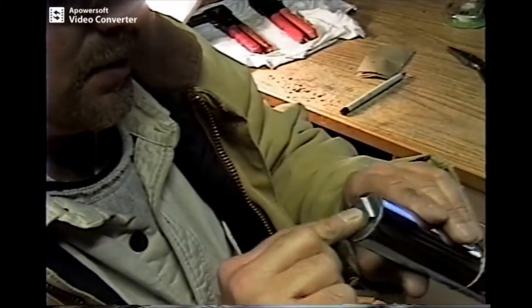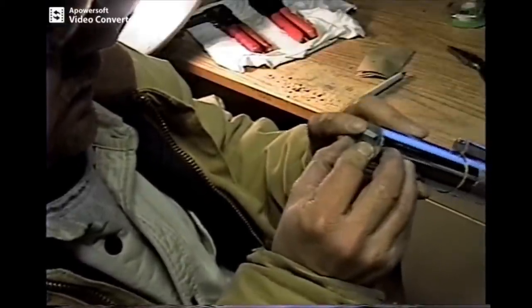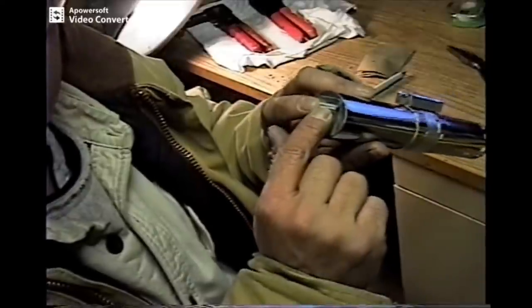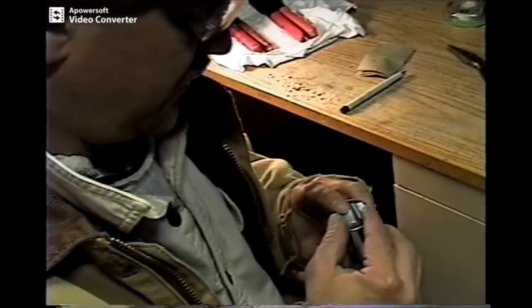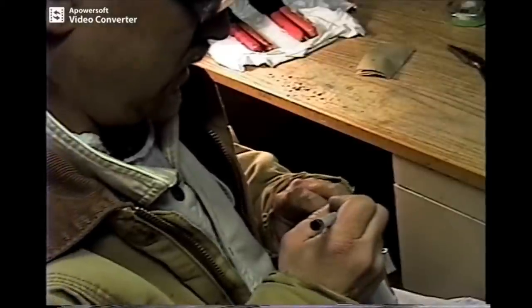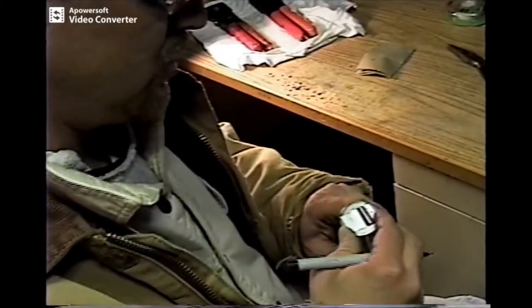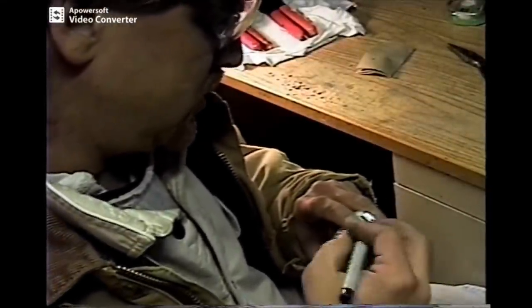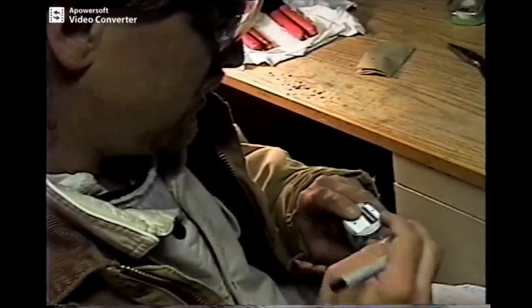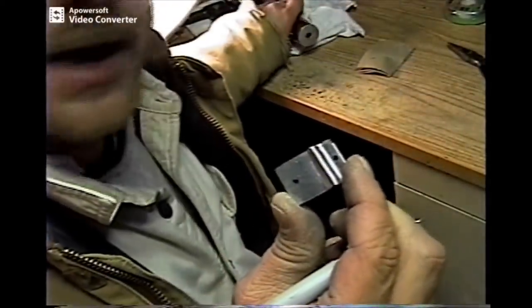Take my tube, smack it on there, make sure it looks alright. Now remember the bent piece here goes right on this side where this clamp piece is at. Take your pen. Make a little mark on top where you want to drill your 1/8 drill bit. Now down here it's a little tricky because you got that hole right here. So you want to do it right below the hole, not too far down. Just like that. And you're going to want to get your 1/8 drill bit and drill these holes out. Alright, I made both my holes.